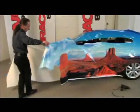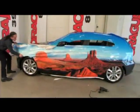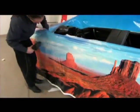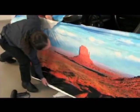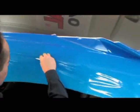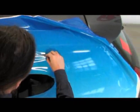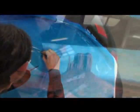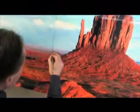The protective paper is pulled off the last third of the vinyl width, and the vinyl is aligned and firmly placed on the vehicle. The vinyl is preheated in large sections and, beginning at the straight edge, smoothed out evenly with the squeegee from the centre outwards. Only after the vinyl has cooled down to room temperature may unwanted parts of the vinyl be cut off. Pointed and sharp blades should be used to do this. Never cut right on the paintwork. The knife can be leaned against edges of existing gaps, for example, the edge of the hood or the door edges.